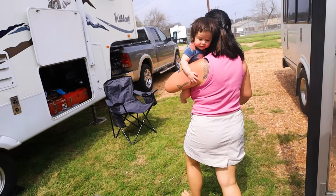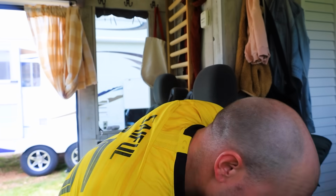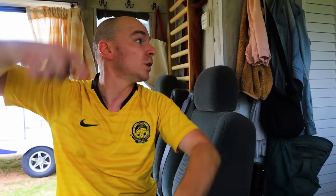Evacuate, evacuate. All right, so the good news is we actually did not blow one of the AC lines when we turned on the compressor. What happened was the people before us must have overfilled the system for the rear AC. So when we turned on the compressor for the first time in however many years, it realized it was overfull and the blow-off valve let a bunch of refrigerant out sort of everywhere in the bus and scared us, but we didn't break anything.